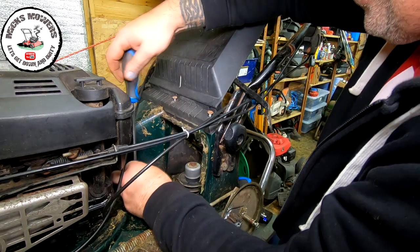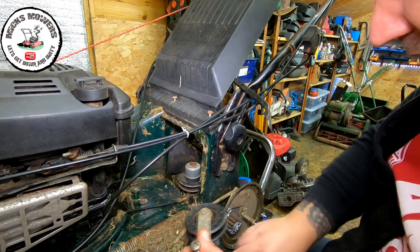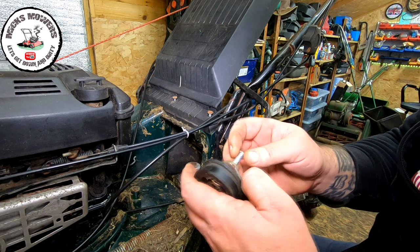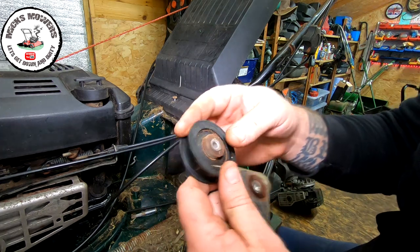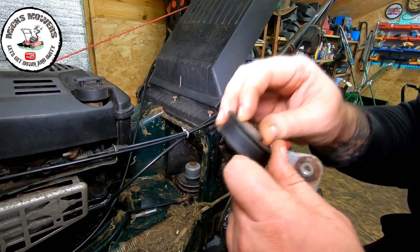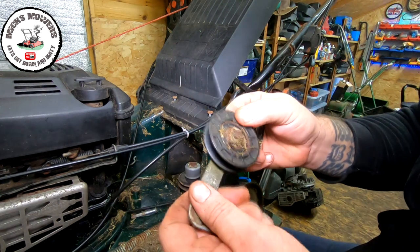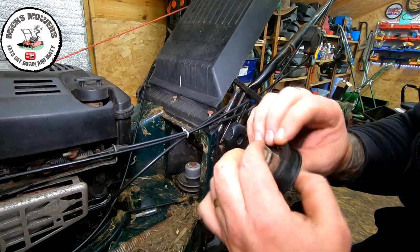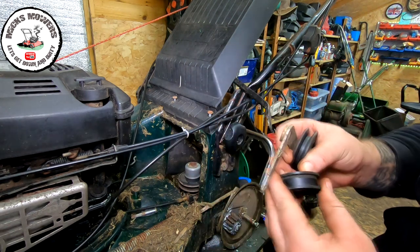Oh, that's coming. Hallelujah. So we've got a washer goes on underneath, and we've got this set up here. As you can see, these pulleys, well rusted, and they ain't doing nothing, locked up. So I'm gonna put some grease into them, see if we can't get them to turn a bit more freely. If not, be new bearings for these. That'd be no biggie. I've got a little tiny collar there that goes upwards, okay? That should free spin. So that's the first problem.